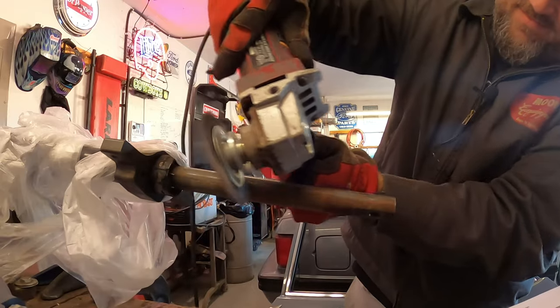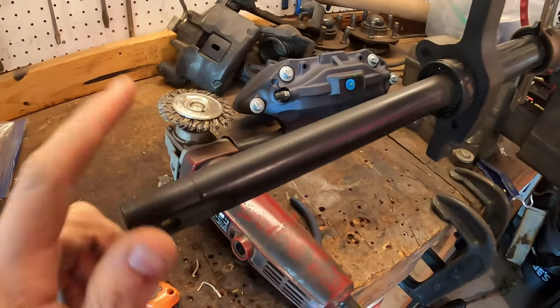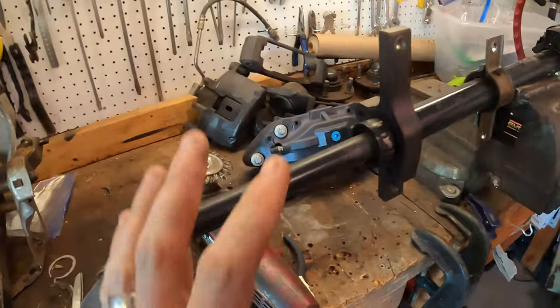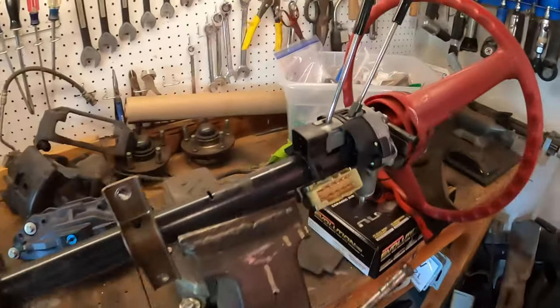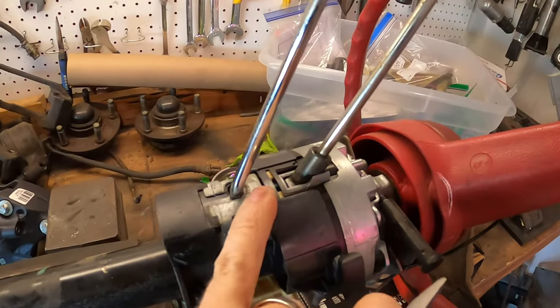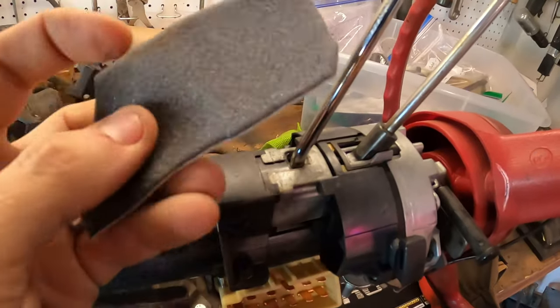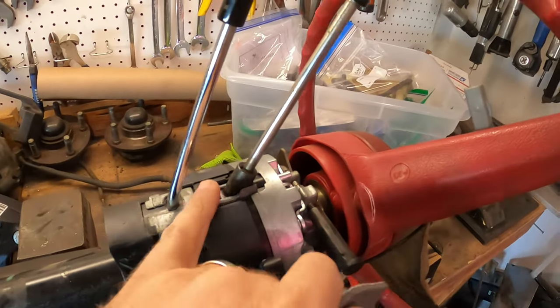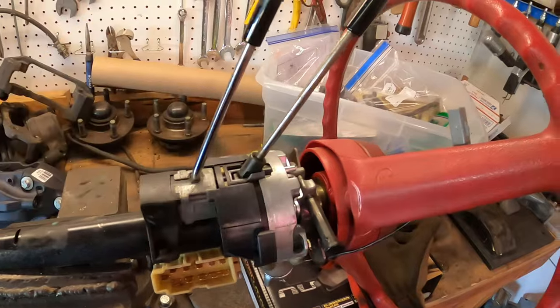Let's get it all bolted back in place. Put the steering column back in. Paint it black and put it back. It looks much better now — it's got a fresh coat of black paint on it. So now when it's sticking to the firewall, it doesn't look all rusty. If you guys know where I can get a seal for this — the firewall rubber seal — everything I see online is for an 87 to 93 and I can't find one specific to a 79 to 86. I don't know why they're different, but I'm looking for a firewall seal for a 79 Mustang. I want to show you something I'm going to try. If you don't want a stock Mustang, there's actually a foam seal right here that goes in between that deteriorates and falls off. I've got an extra piece of headliner here — on the back side of it the foam is real similar to what these are stock. So this kind of gives it a clean look whenever you put the plastics on it. I'm going to cut a couple holes and slits in it and slide it down and see how it works. Give it a shot. If it looks like crap, I'll pull it out.